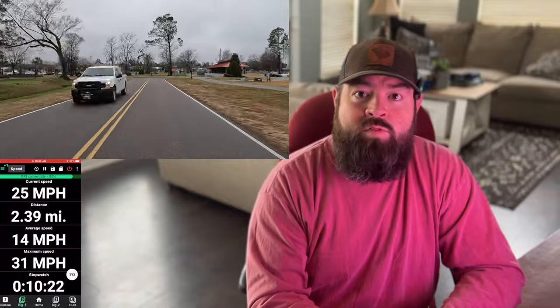With my golf cart on these range test videos I usually keep my amperage output around 200 amps. Let me explain a little bit about amperage output on your golf cart. Generally, factory golf carts have a 225 or 250 amp output controller — that's what it's rated at. That does not mean your controller is going to be producing 250 amps at all times. There are a couple of things that will kill your range on golf carts.